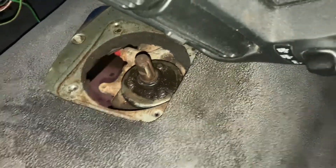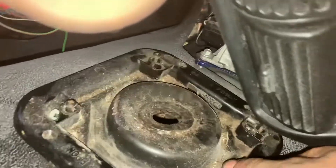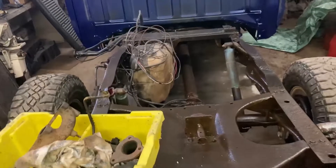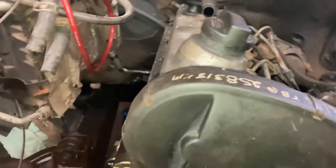I'm in a pretty good spot now. Here's the plate that goes in there — it almost fits. If you put it where it is factory, it's about an inch over, but not a big deal really. If you stand back and look at the driveshaft it looks straight — no weird angles on anything. So as far as I can tell that's going to work out great, and I'm happy about not having to buy driveshafts — that's a big deal.